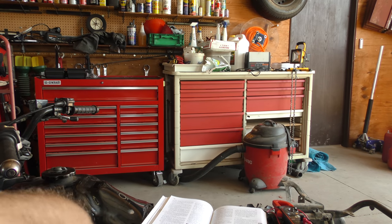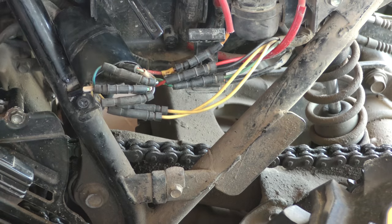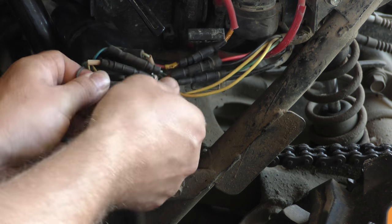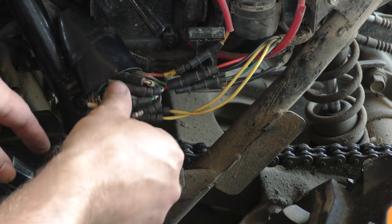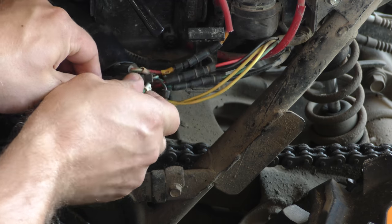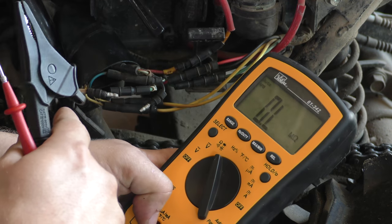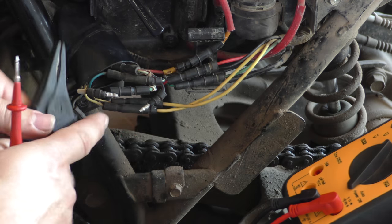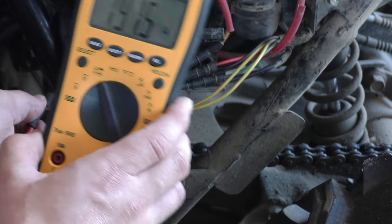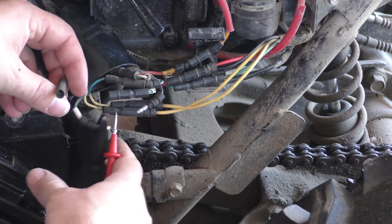Let's adjust the camera here - zooming in on the wires. I got a black and red, which is that one there, and then I have this green one which has white markers on it. That's it, so I'm assuming it's this one here. The tester we're going to set to ohms, set to auto. And we got a reading of 191 ohms. It's supposed to be between 100 and 300, and it's at 191 - that means it's within specs. I'll connect that back up.